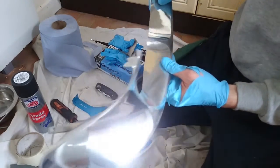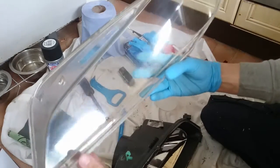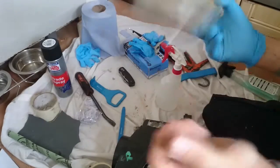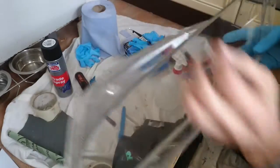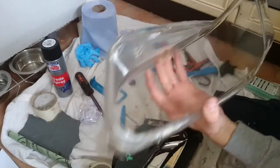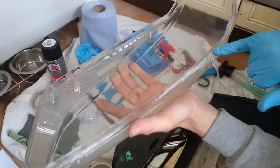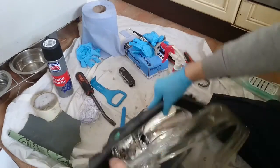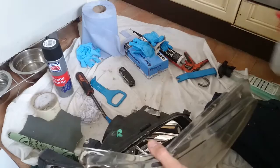Right, we'll put that one in the oven and do the same. Once you've given the lens a good cleanup - to be totally honest the important bit isn't the outside, because you're going to get that dirty and possibly some silicone on it - but you just want to make sure the edge has got as much silicone removed as possible without damaging it. Make sure the inside is clean because once you've glued it onto the headlamp, that's it.